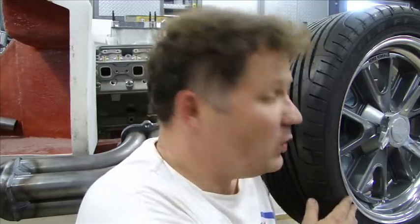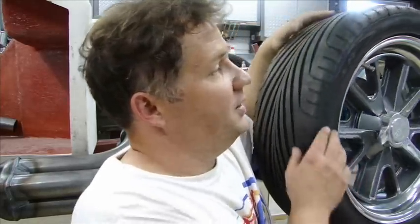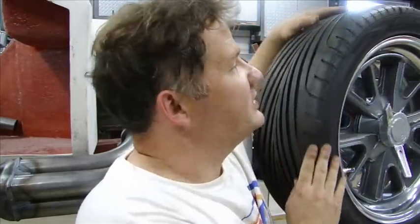There are repair processes in the tire building industry after tires are cured. For example, if a tire comes out of the mold with a little nick, they'll clean off the area, put some black wax in there, rub it smooth, and spray flat black paint or black ink on it so you won't really see it. So when you buy the tire, rub your hand around the outside and look very closely at the entire outside face of the tire for defects — you'll be able to see it if you look close enough. Look at both sides, inside and outside, and look at the tread for defects. Some tires have little nubs on them — that's just rubber squeezed out through the mold vents, no big deal, those come off very easily.